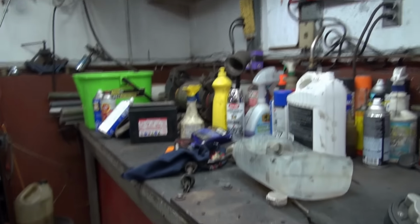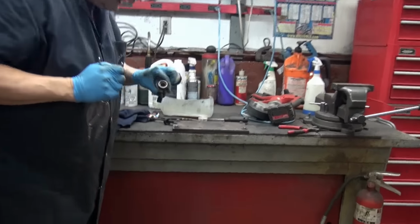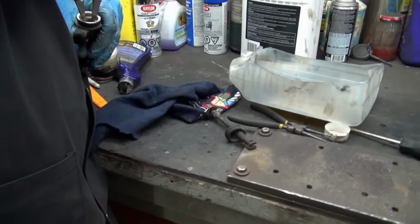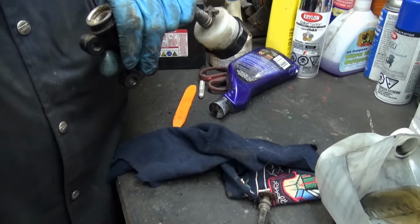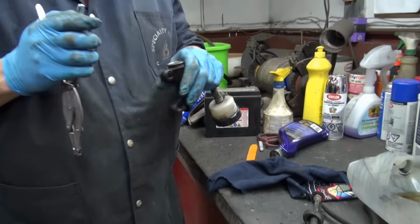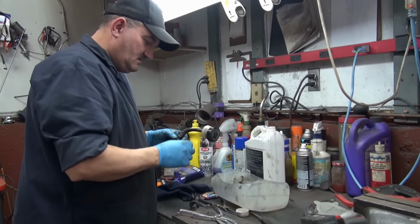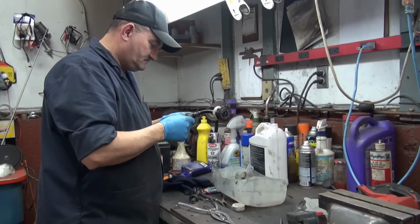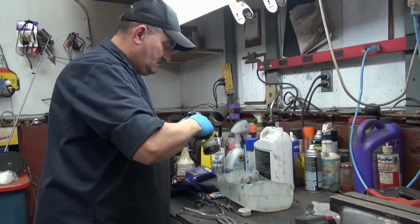I don't think the brakes will work on this regardless. No? Because the piston in there is seized into the cylinder. Oh. Yeah. It's bar tight. So he technically never had any back brakes. He thought he did because they were hard. Yeah. They weren't working. No. So I got to dig in deeper, and I got to take this apart, and I got to see if I can heat that up somehow and get that loose. A whole new mess of trouble.